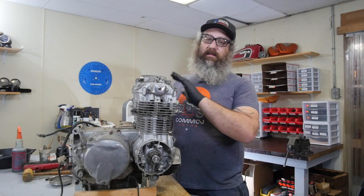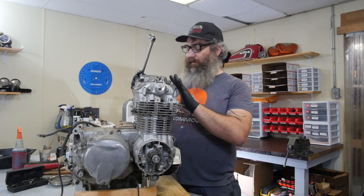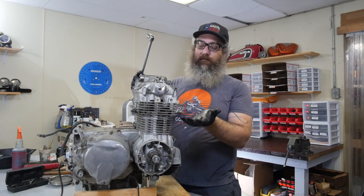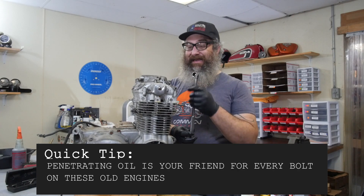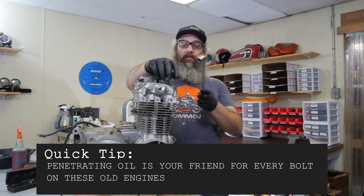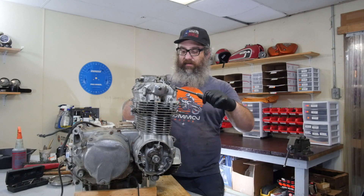We'll put the cover back on, set the valves, and then move to the lower part of the engine. I'm going to take off all of the valve covers, or at least break them loose. I'm using a 17-millimeter six-point socket so it grabs really well on my breaker bar, because these things tend to be stuck. All those guys are loose — a lot of people over-tighten these covers; they shouldn't be that tight.